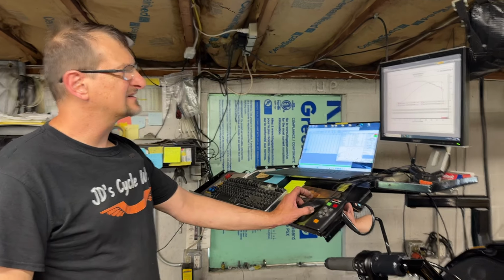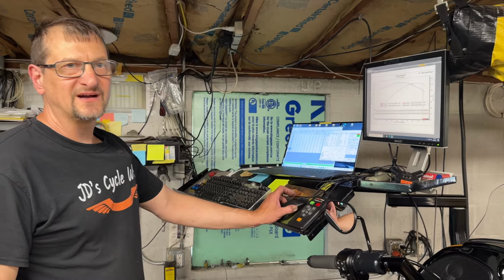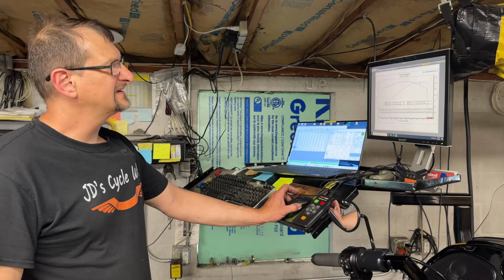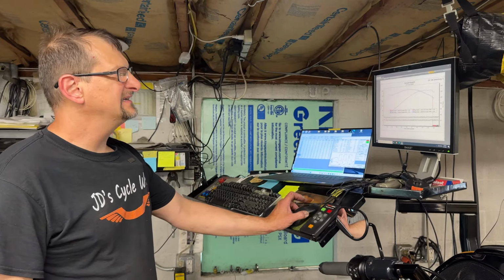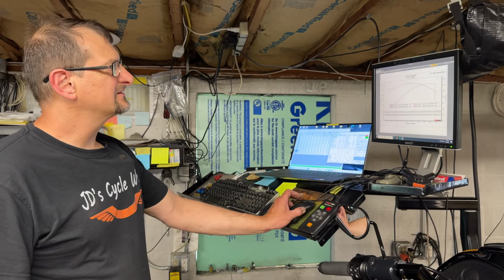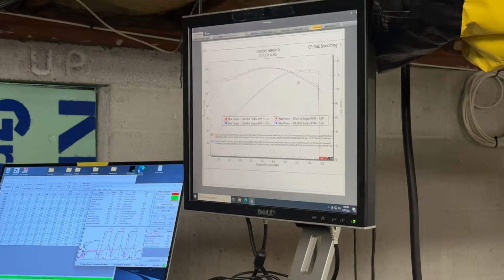Let's say when your bike comes in or goes to a shop and yes, it is smoking, it's consuming oil, the valves are leaking. Hey, maybe have that plus one valve put on there, a little more head gasket, keep the same stock size, maybe some fresh rings, and you know you're gonna get a little more power. Not everybody needs a big cubic inch engine. 136 foot-pounds of torque, 130 horsepower, that ain't bad.